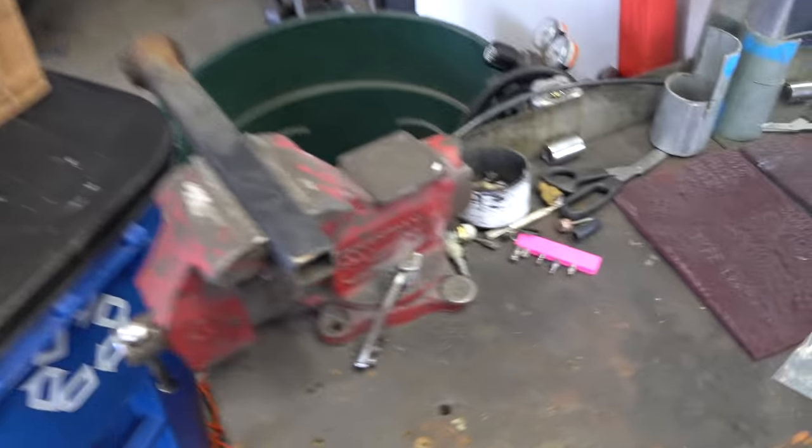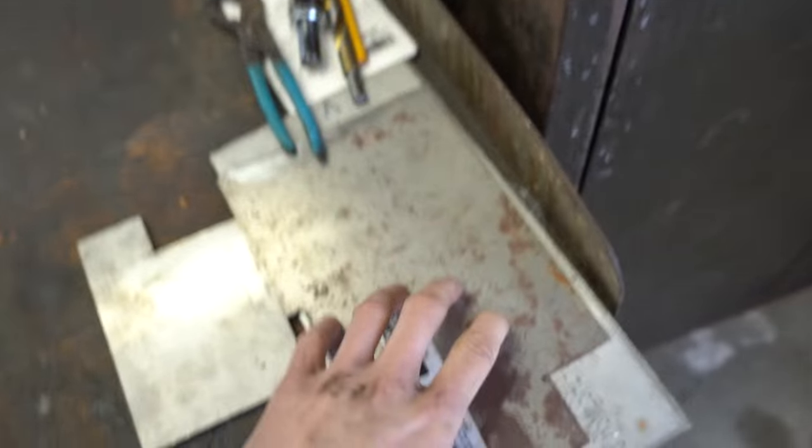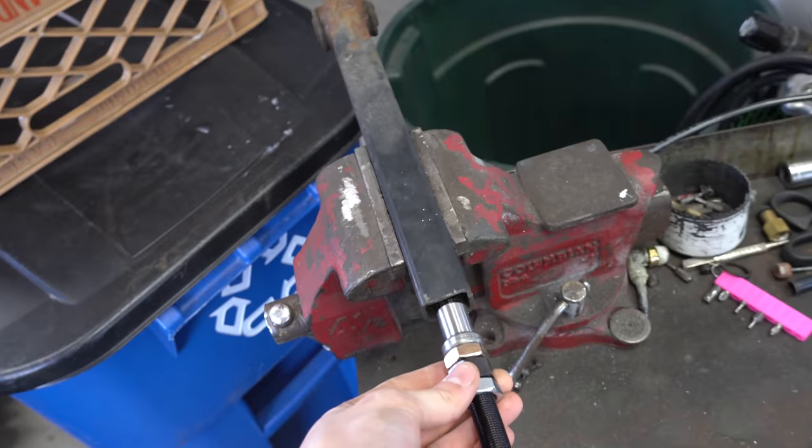As you guys saw, we got the arm all cut up. We got the three and a half inch piece on the floor here - that goes to the trash. We got these two pieces we could just sandwich together - honestly we'd have like negative 30 degrees of camber if we did that. We're going to clean these up, get these bungs all prepared, drill a hole into that steel so each bung can be welded in. We'll be able to extend this thing three and a half inches back to stock, or sink it in three and a half inches - give or take with the nuts, about two and a half inches of adjustment.